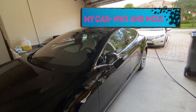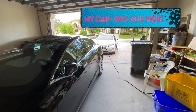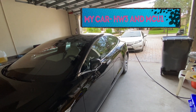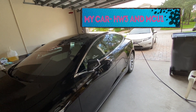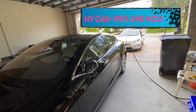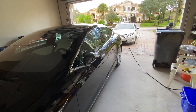I plugged the formatted drive into my car after the upgrade and it was recording everything — the front cameras, the side cameras. The only thing it does not record is the rear camera. That's the catch: in autopilot 2.5 with the newer cameras, something in the software enables rear camera recording. But in this particular case, if you upgrade your hardware to 3.0 and still have the older 2.0 cameras, the rear does not record. That's the only thing my car doesn't capture.